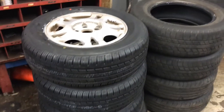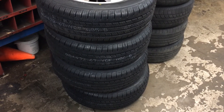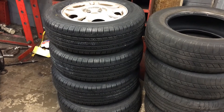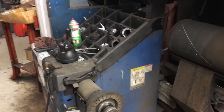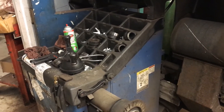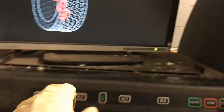So we now have four nice new tires mounted up and four old tires off the rims. I sped that up some, but for those wondering — since we did our tire relay races — the three tires you saw me do in quick fashion took me a little less than 13 minutes, about 12 minutes and 45 seconds for those three. Now we need to take our nice new tires and bring them over here and road force balance them. Any time a tire is off a rim — whether to repair it or completely replace it like we're doing — we have to balance it once it's back on the rim, otherwise the car will not ride down the road smooth.